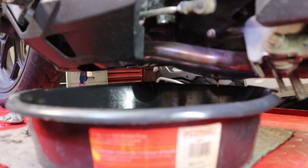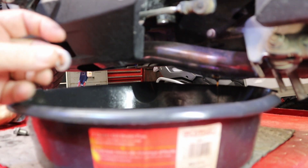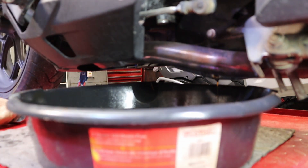I should say this is actually a 2014 CTX 700N, as in Nancy. Now, one of the things we do want to do is use a new crush washer. You can buy these cheap — heck, you can buy them from Honda cheap. They squish once and then they don't ever squish the same again.